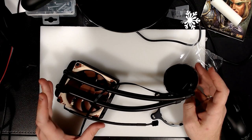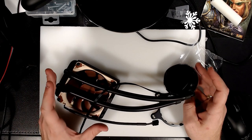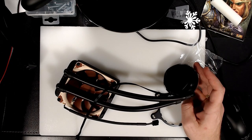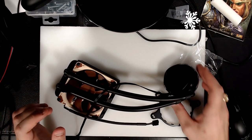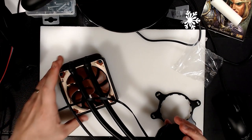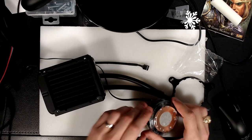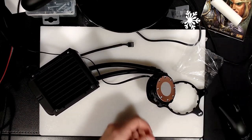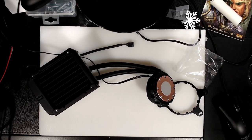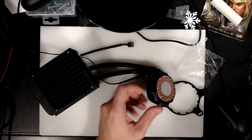The big benefit is it's also gonna be moving the heat source from on top of the motherboard to the bottom of our chassis. We'll do a little overhead shot of that here in a second. But we're gonna go ahead and start doing the assembly. This cooler comes with the pre-applied thermal paste. We will be removing that, mainly for consistency, and also, I hate these little pre-applied pads.